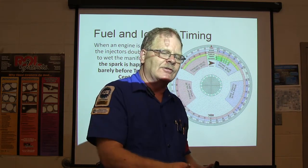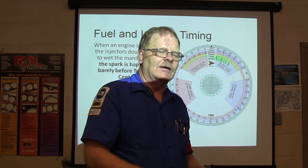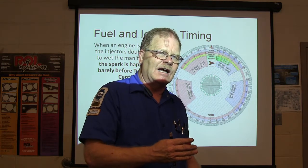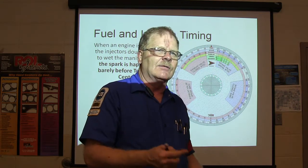Somebody had dropped the distributor in it and just figured if they got it running, whoopee, it's running. But they didn't actually pull the spout connector on it and set the timing, and we put the timing on 10 degrees and it ran like a brand new truck.